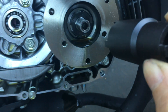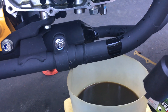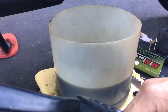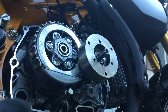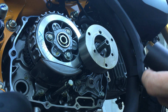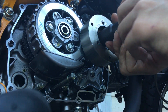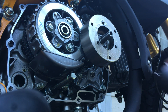So I could use this now. I just need to put an extension on here because my socket drive won't fit on here directly. So there are several ways of taking this nut off. One way is to take this on here and use an impact driver — it'll come right off, you don't need anything else. If you don't have an impact driver, you could use a holding tool like this right here.